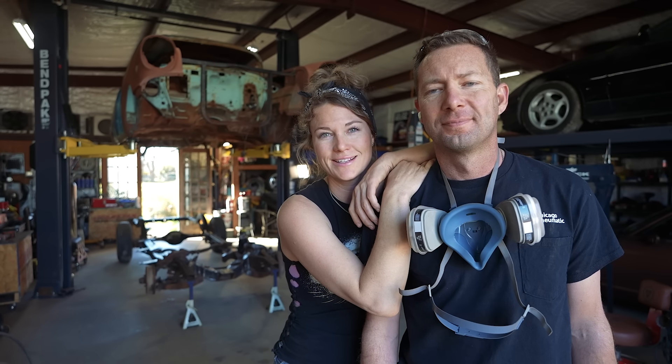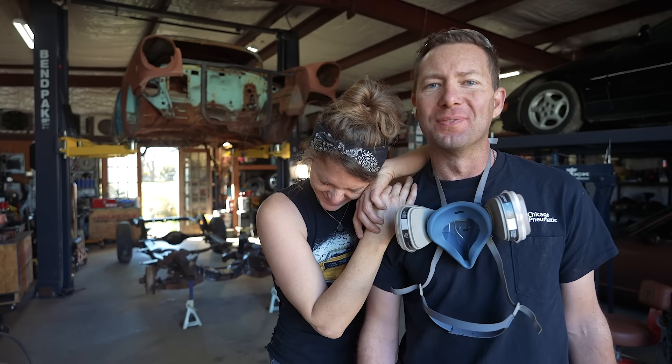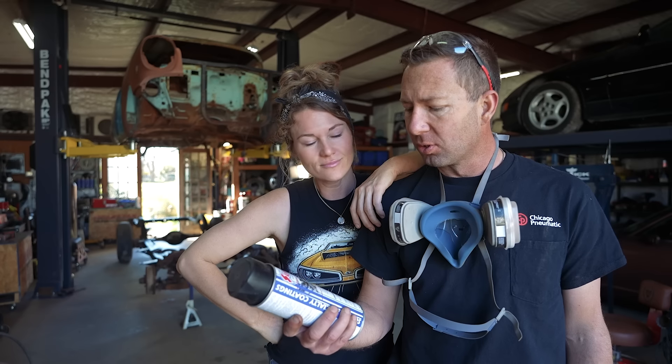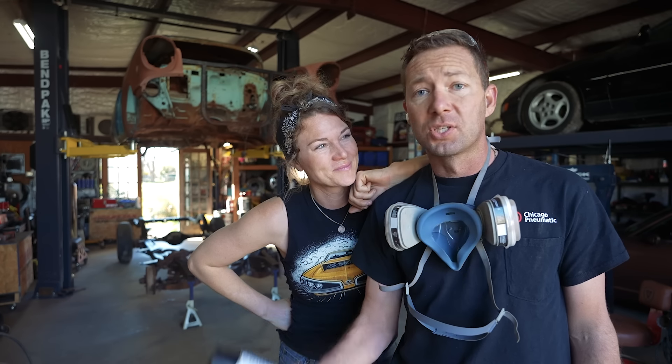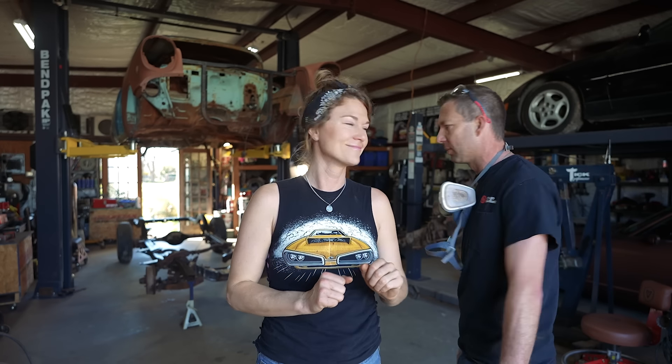We are sufficiently dirty — we've sandblasted our faces, wire brushed everything in this shop. There was a mountain of debris that came off that frame, but it looks really good right now. We picked up General Chassis Enamel — it has a picture of a chassis on it. It says gas and grease resistant, which is important because we're probably going to leak gas and have some leaks. So we got a bunch of cans and we're just going to start laying this stuff on. It's going to be semi-gloss, which I prefer for chassis — I don't want it shiny and I don't want it matte. Semi-gloss — not too shiny, not too dull.